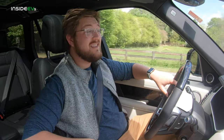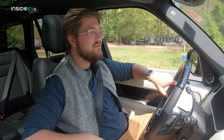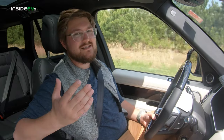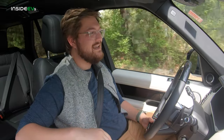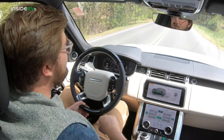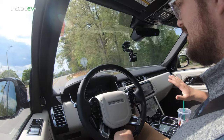After spending the day with it, I would almost argue I'd buy this drivetrain over any other Land Rover drivetrain in the full-size Range Rover because it's just so quiet and seamless. You're never driving these for speed — you're just cruising around, and here we are in silence. It has regen braking — a blended system where lifting off coasts the car and touching the brake charges the battery. I'm predictively charging for a stoplight. Zero miles showing but power does not seem degraded and acceleration in electric only seems the same. We're at 7% state of charge.